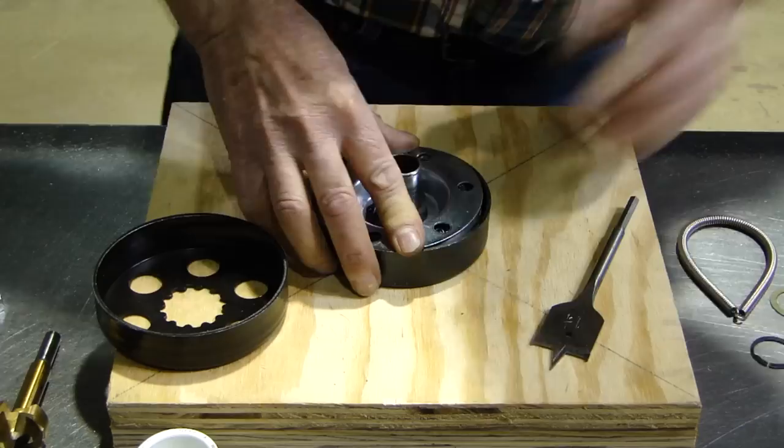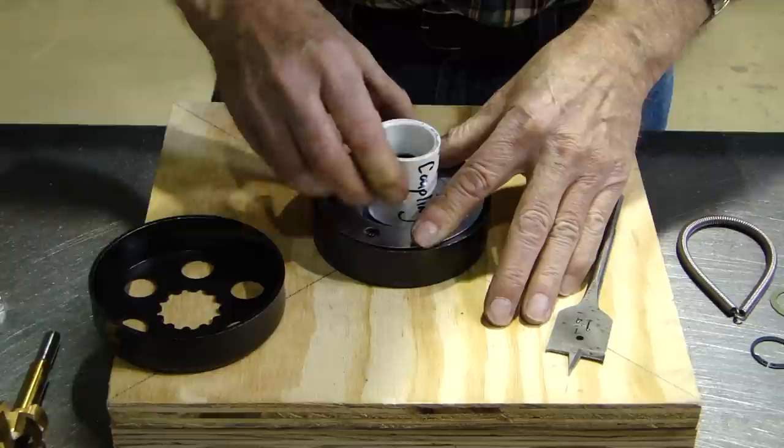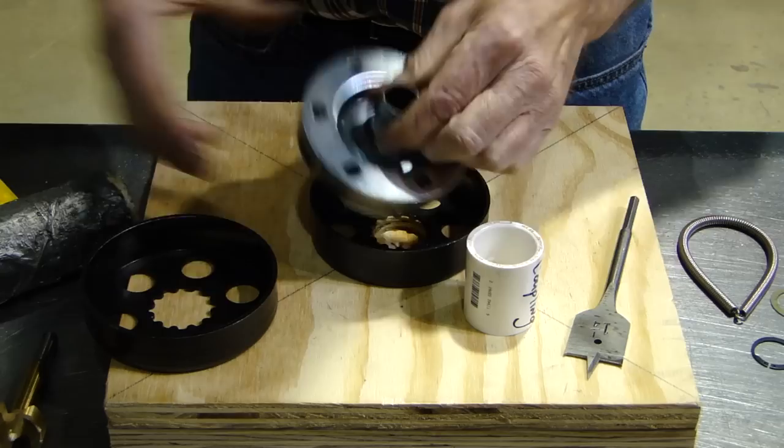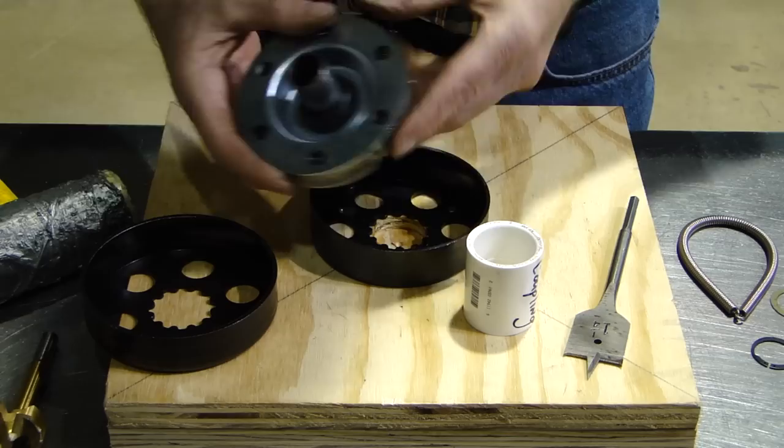With it down, you take that one-inch piece of PVC, put it over the snap ring, take a large hammer — or the flat of a hammer like this — and just whack it. The snap ring slides down over the taper and completely closes. That's the simplicity of putting it back together using the drum to contain everything.